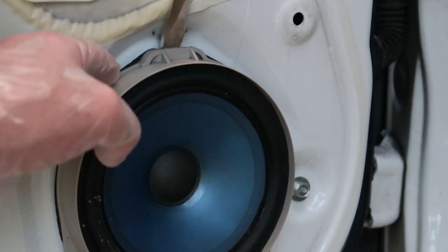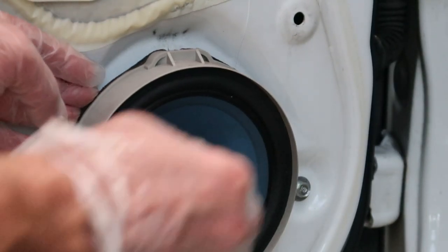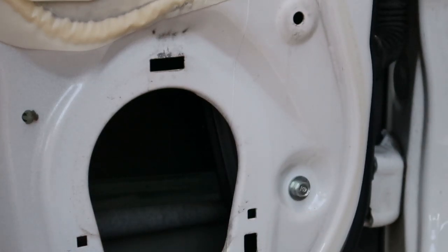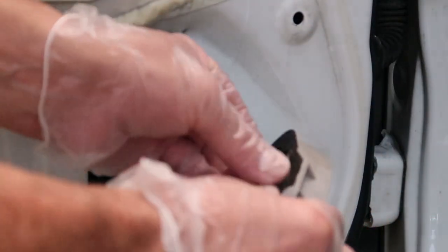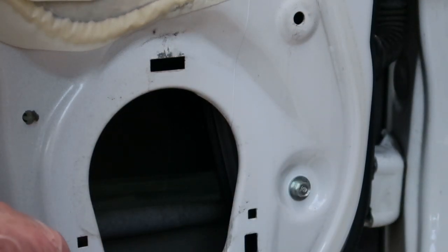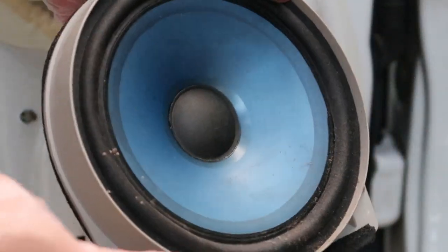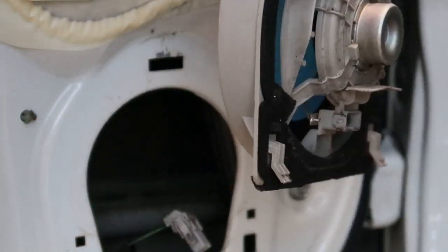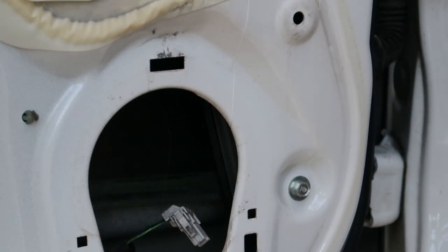At this point, you're going to need a very large flathead screwdriver and you're basically going to push down really hard on that top clip, pull out, and the whole speaker just slides right out. I'm going to show you a better view of what that clip looks like. Push down on that clip and it should pop out of the door, and then we can remove the electrical connections from the speaker. The key here is we want to save this structure, cut the speaker out of this little mount and place it right back in for a factory fit.